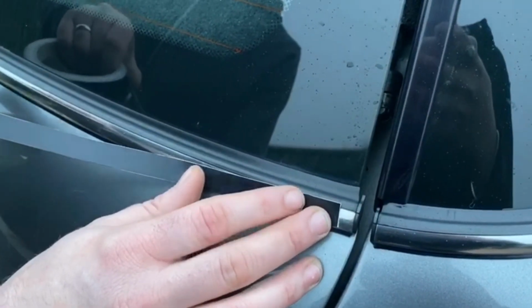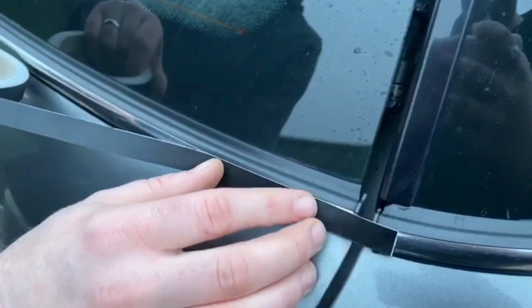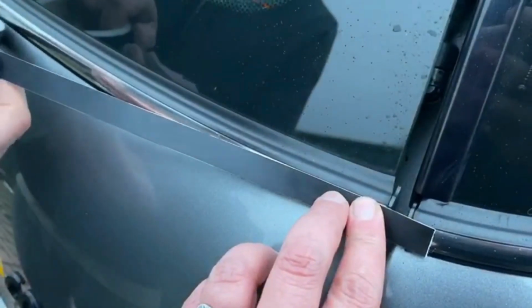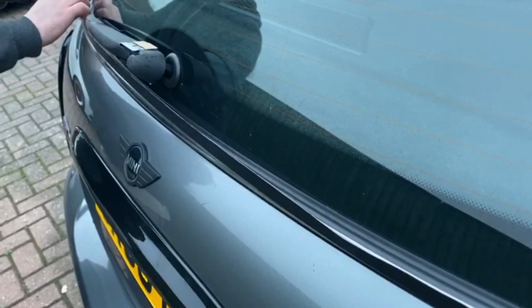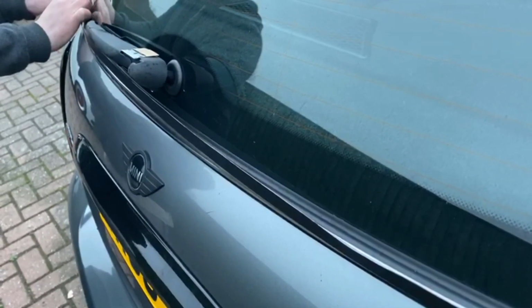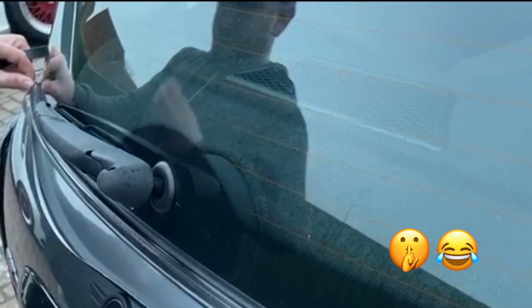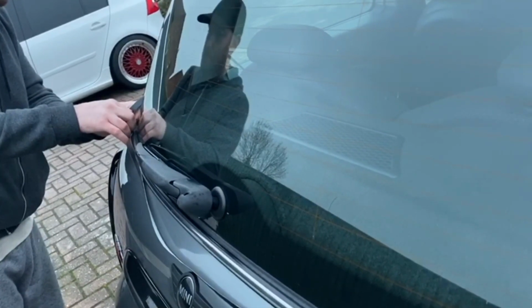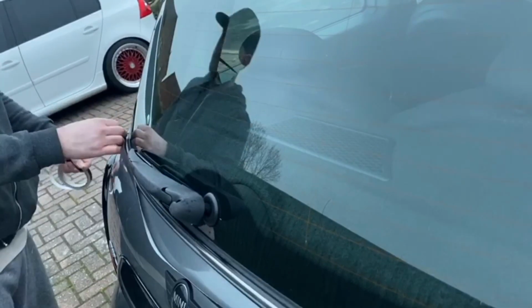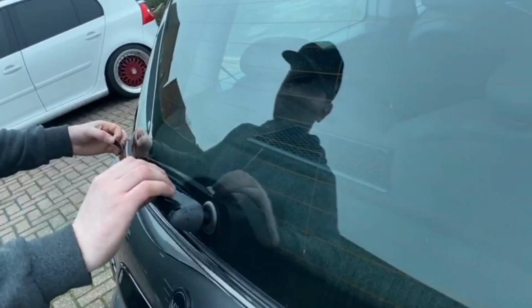So now doing the belt liner kit. So this goes around the line of chrome that goes underneath the window. So I'd say the best thing to do, if you hold that, just overhang it an inch or 2, and then run it along the section that you're doing. So you've got a rough guide, and then if you just cut it, you get like a little scalpel thing with it in the packet so that you can get a nice clean edge when you cut it. And that's there.